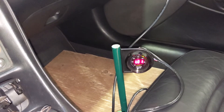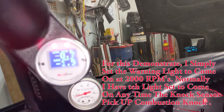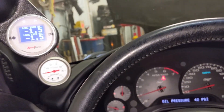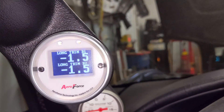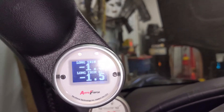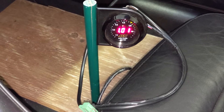Now for those of you who just cringed a little at that statement, please know that I do have a knock sensor warning light set up so any time I get any knock it alerts me. I also tend to watch my long term fuel trims closely, which would likely give me fair warning of a developing fuel related issue. Using an attached cable connector, I do connect my wideband to HP Tuners for scanning purposes any time I'm doing any tuning and for every weekend at the track.